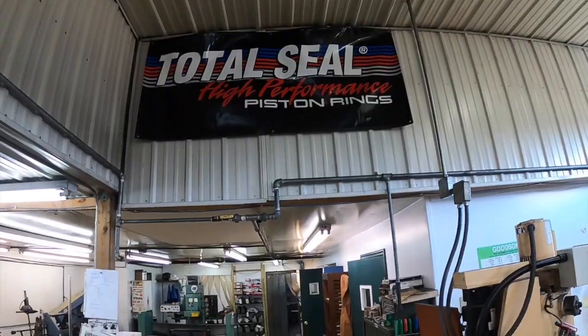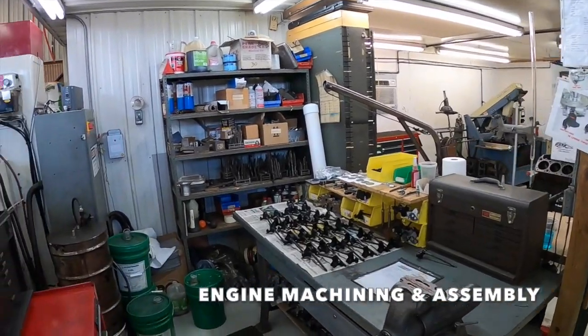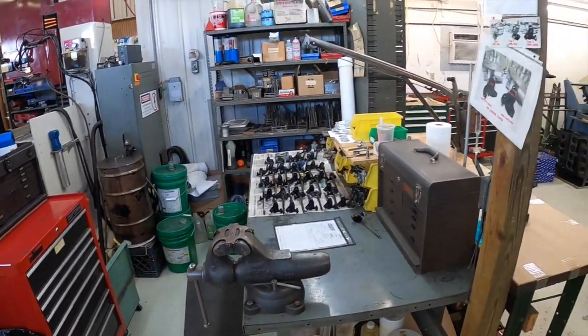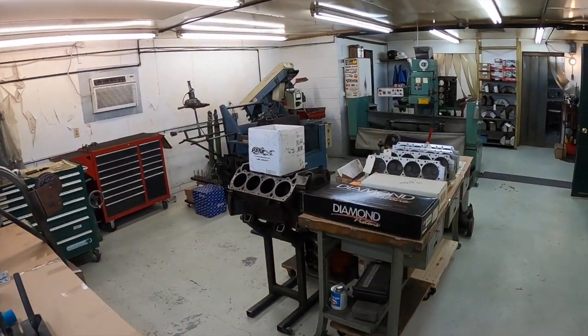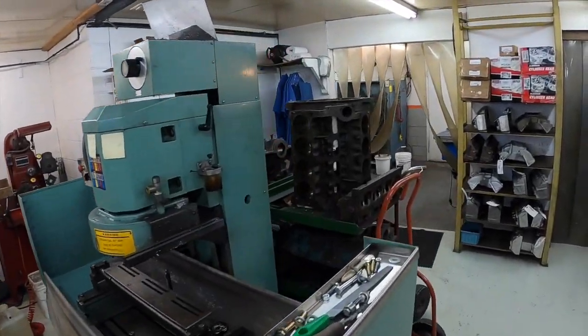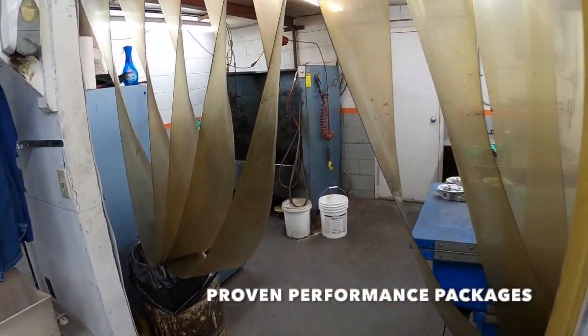Right now, we're looking at not going terribly crazy. Ultimately, our biggest problem is that the Charger — even though we're 535 cubic inches — we're just running at a top end around 5,500 to 5,600 RPM and we start to lay over. And that shouldn't be happening for another 1,000 RPM.